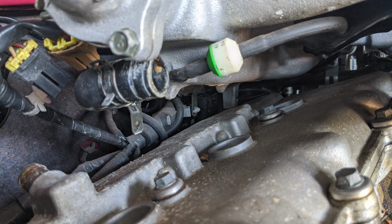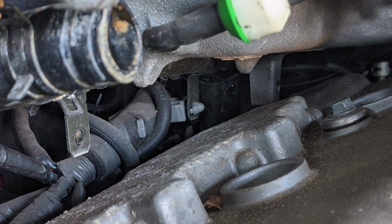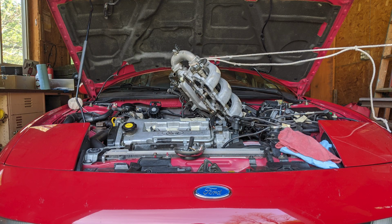Lift it up partially and disconnect this hose from the stem on the valve cover. Support the intake manifold by placing a small block of wood across your valve covers. You want enough extra space to expose this area. Reach in and try to disconnect this gray fastener from this bracket. I managed to do it by pressing on the side of the tab with a very long flathead screwdriver. You should be able to lift the manifold up completely now.